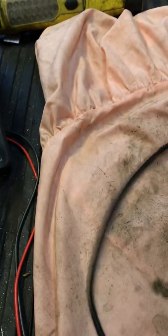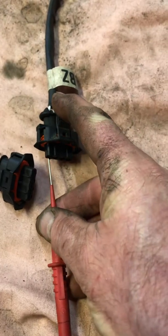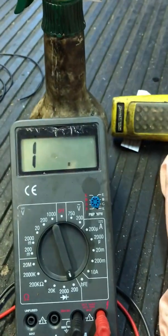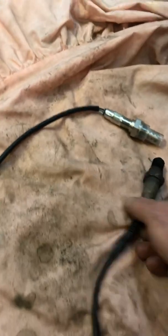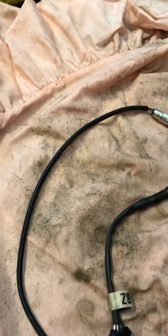If I just pin out the damaged one — the one that's no good — you see there's nothing happening there, so this sensor is actually dead heater-wise, and that's why you get that fault code. I'm going to replace that sensor — simply screw it in, plug it in, erase the fault code, and it should be good.